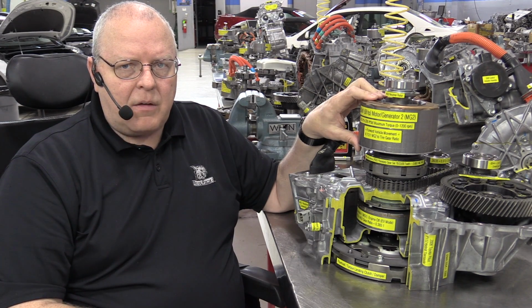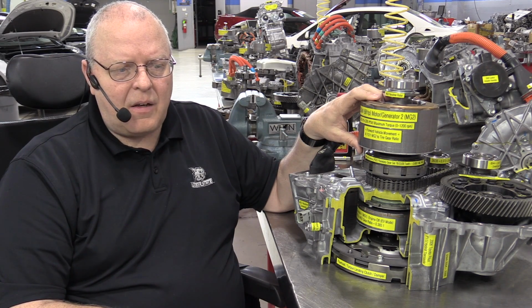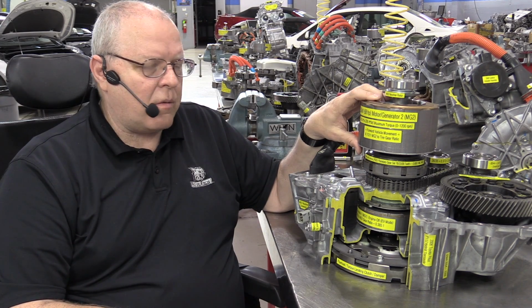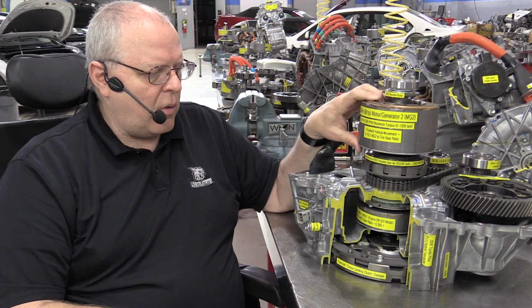By the way, if you put it in neutral and coast, there is no regenerative braking that takes place at that time. It will not charge the battery. It will not regenerate either. I'm not sure electrically what happens, because you're still spinning a set of magnets inside of a coil of wire. It's possible that the resistance is just turned up really high in the controllers for the stator, and it just creates extra heat instead of charging the battery or cranking the engine over. But neutral position does not give you any charging.